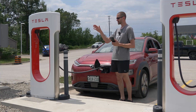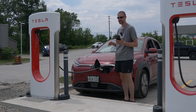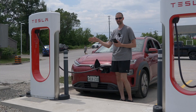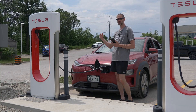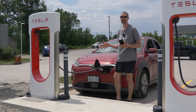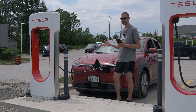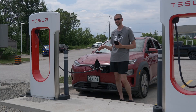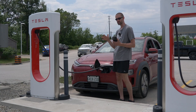The communication is done and the vehicle is charging. The Hyundai Kona is only capable of up to about 77 kilowatts. Keep in mind this is a 400 volt system at Tesla superchargers, at least for version 3. Version 4 will be more compatible with higher voltage cars. If you bring a Hyundai Ioniq 5 or Kia EV9, you'll find charging speed is about half what's promised — 400 volts into an 800 volt car gives you only half the speed.